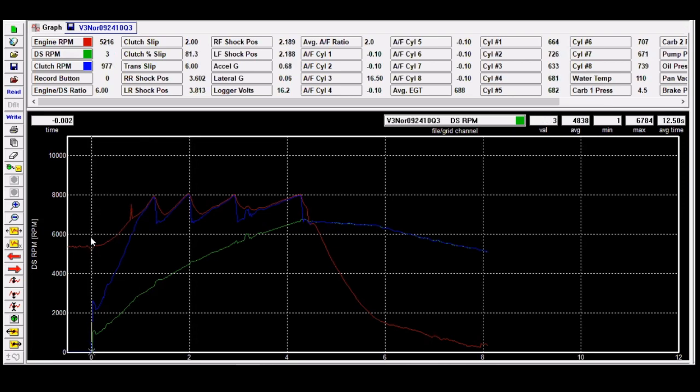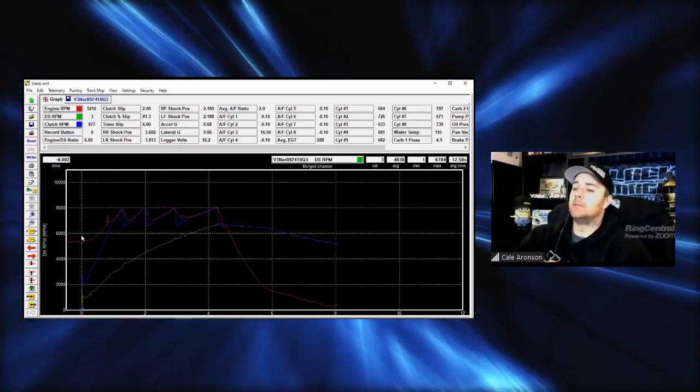If I were to just add, and I can tell you from experience, it would have taken about 9 grams to get it where I wanted on this particular clutch, which, by the way, we would run anywhere between 140 and 180 grams on a car like this a lot of times. Some guys run them differently; this is just my setup from several years back. As an example, I would have added about 9 grams. The 9 grams would have given me probably about 300 pounds of extra plate load pressure, which would have locked the clutch up about 200 RPM sooner.